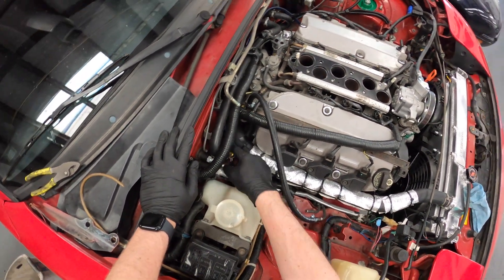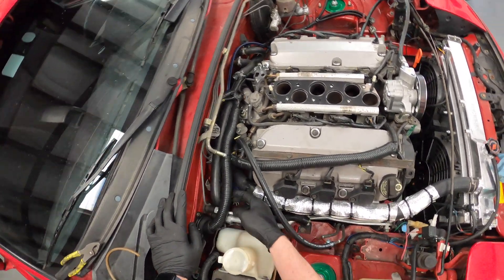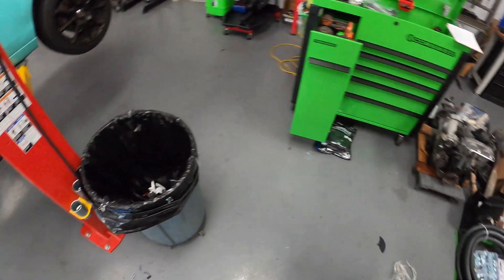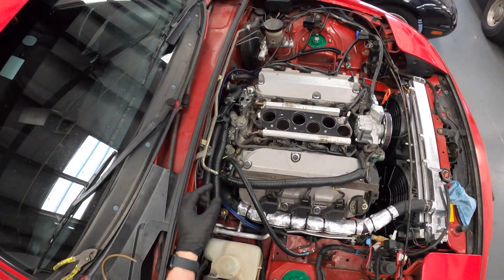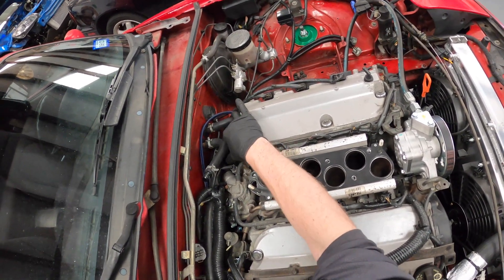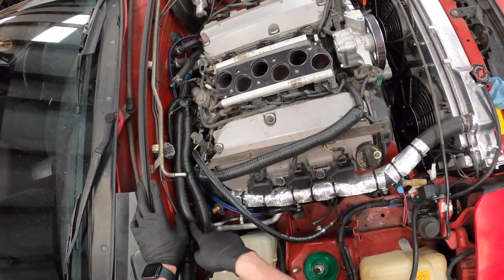I figured out the 5/8 hosing coming out for the second heater core line and the routing for the 3/4. I'm not sure if I'm going to use this preformed hose with the tight 90 — it's not connected currently — I may just use regular 3/4 by the foot instead. These two hoses down here are both 5/8, from a Continental C87677 — kind of a shaped hose that I split, getting one piece here and one piece there, with a 5/8 union at each end. The other is an OEM Mazda hose for the heater core, cut a little shorter, with a 3/4 to 5/8 union down there and two very tight-radius 90s.